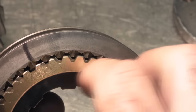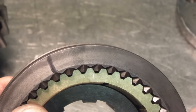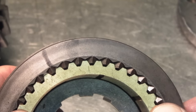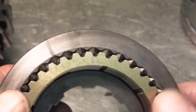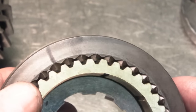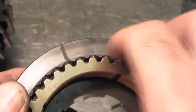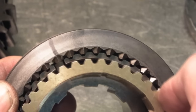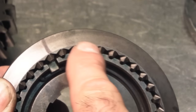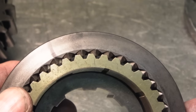So what happens is: if the ring is going this way, in order for the slider to go past it, it has to push the ring in the opposite direction. On an upshift the ring has to go that way for the slider to come through; on a downshift it may be the other way. This is going to happen very fast — this indexing action happens in a split second when you're power shifting at high speed. If a ring is wearing in the slot and allows the ring to over-travel or over-index, you'll end up with a point-to-point condition where the ring goes straight up against the slider. Or these teeth can get really mashed from someone missing a shift, which means the slider can't come over the ring and the ring can't index properly — what I call a block-out condition.